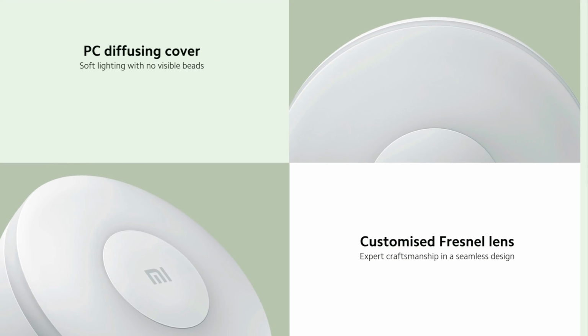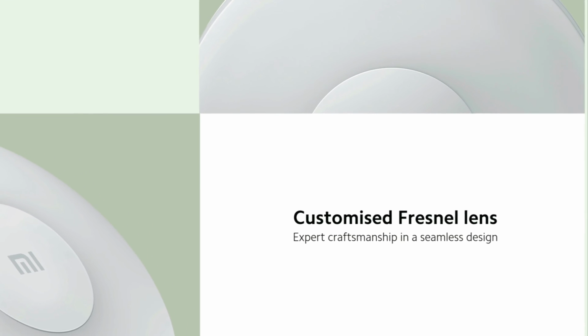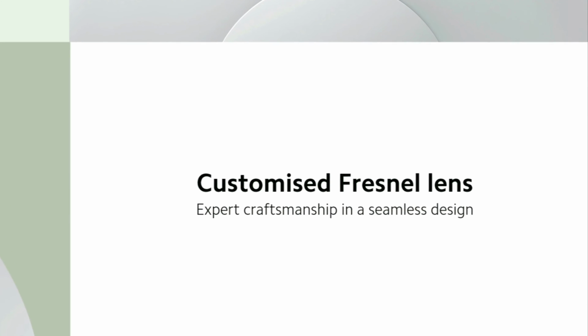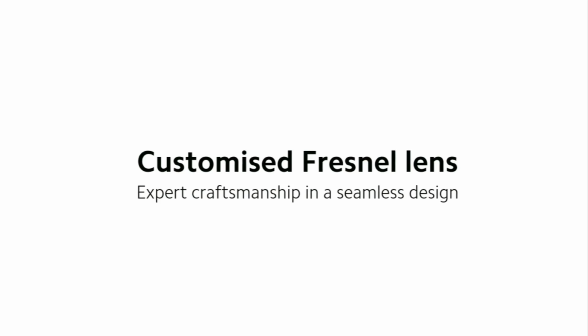The Night Light 2 uses a Fresnel lens which directs beams of light to the same point and thus improves detection of changes in ambient lights that human movements may create. Xiaomi says the Fresnel lens is customized to achieve this. The light turns on automatically once it detects human movement in the dark and turns off after 15 to 60 seconds depending on your setting on the Mi Home app.